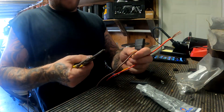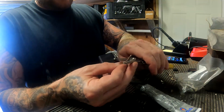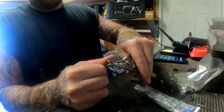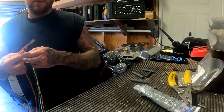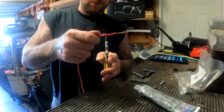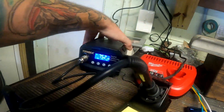I'm going to cut off both of these up at the top because we're going to tie these together. Leave yourself a little bit of wire. Give yourself a decent amount stripped, and even a little more because I'm putting two wires to it. Open it up real good and grab your other two ends. I'd buy a good soldering iron - I forgot to turn it on, so we'll let this thing warm up real quick.